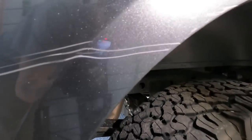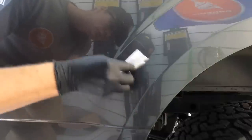Let's head over to a repair that is quite impressive. This long scratch — some of it is topical, some is through the clear coat, some is through the clear and color coat and down into the panel. We're going to use this repair kit. We have already compounded. Let's apply the clear coat resin, let it cure, and take a look. We use the exact same process as on the blue colored vehicle.